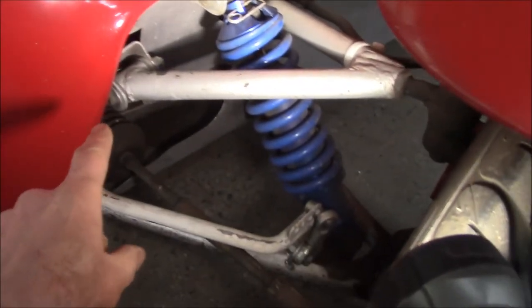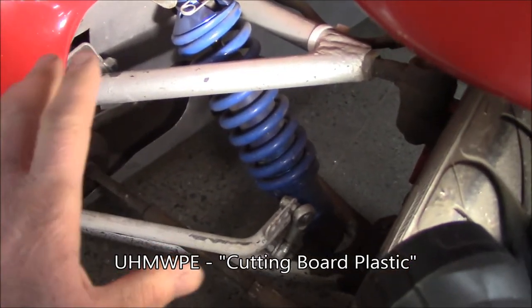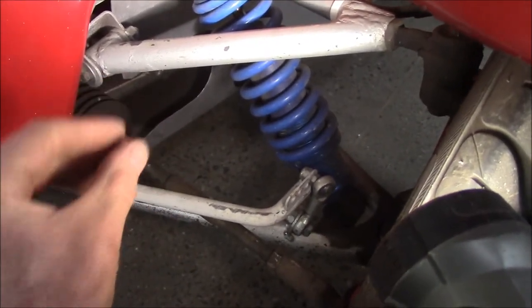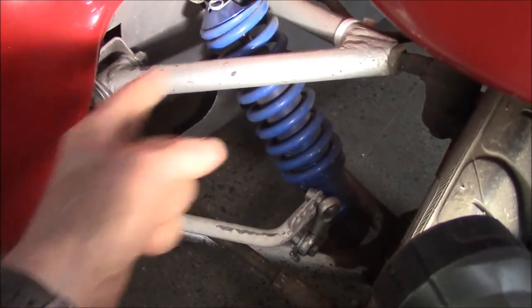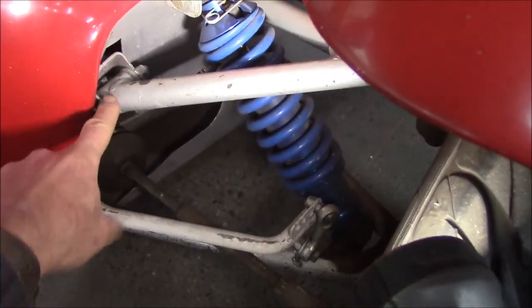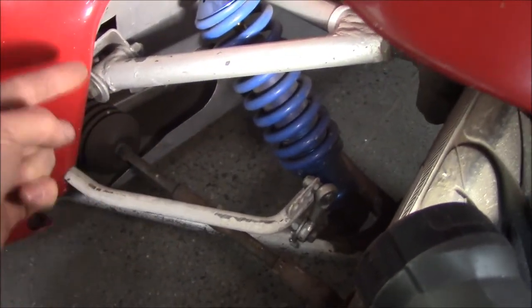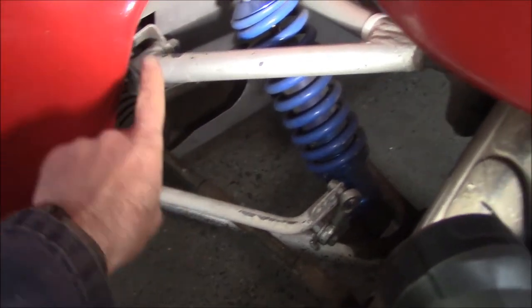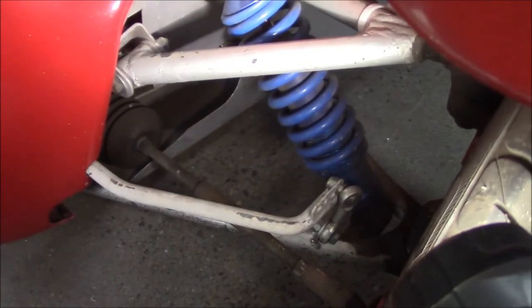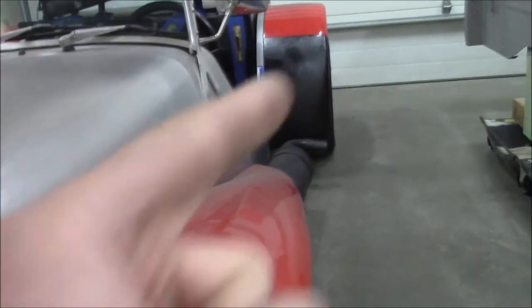Here's what I did. I originally did the entire suspension bushings with ultra high molecular weight polyethylene plastic — essentially cutting board plastic — which is very slippery and very rigid, which in racing is cool. In this front suspension it's very, very cool. It works good, it slips, it moves, it controls everything. It keeps these control arms pivoting in this location and doesn't deviate from it. This is an awesome place for ultra high molecular weight polyethylene, Delrin, polyurethane, or plastic — anything. This is a good way to go.